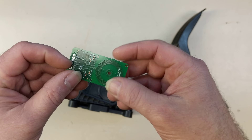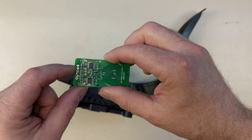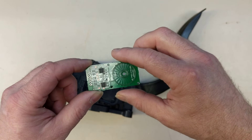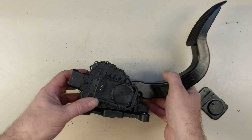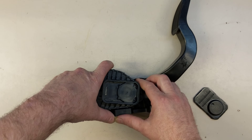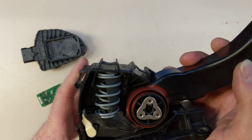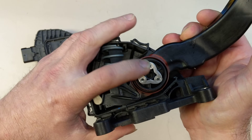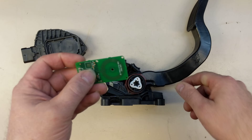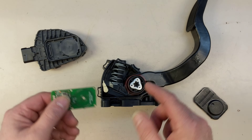This is a really simple, cheap circuit board. There's six wires on here — basically two separate circuits, one for each slope, and each one has three wires: ground, 5 volts input, and an analog voltage output. That's repeated for the other section, so six total wires. The top cover just has the connector for the wiring harness. Inside you see this strange three-sided piece of metal. As you press on the pedal, you compress the springs and rotate this little device. This is what eddy currents are induced in by the transmit coil. It basically sends a high-frequency AC magnetic field down to this, and then the two sensing coils sense the position of it.